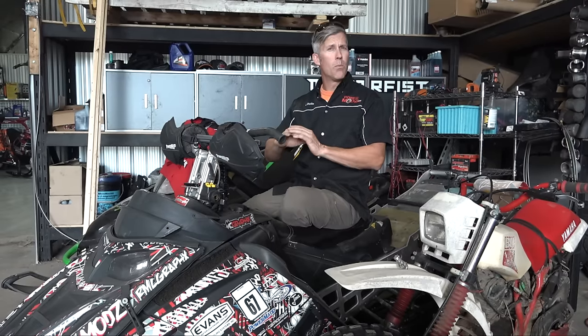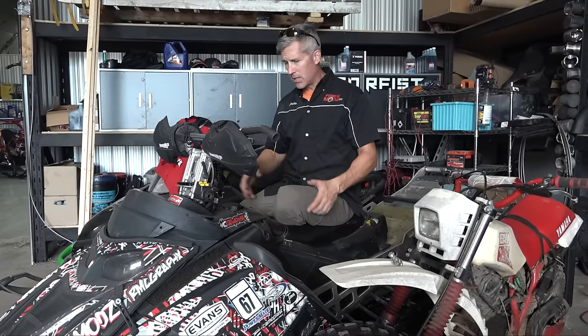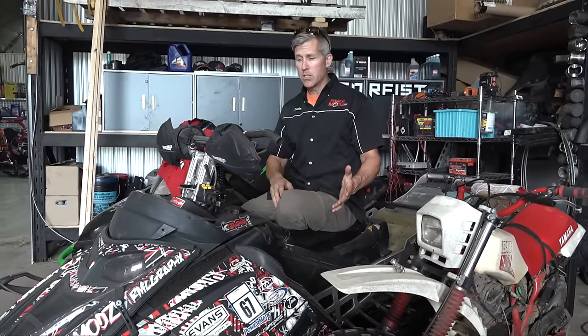Take a quick look around all your wiring harnesses; make sure no mice have gotten in there. If you see little bits of corn niblets, acorns, and pine cones in there, you know something like a squirrel has been messing around. Squirrels love to chew on wire insulation and they can really screw up a sled. If you have electric start, hopefully you had your trickle charger on it all summer long — make sure that battery is topped up and ready to go.